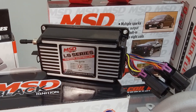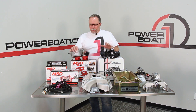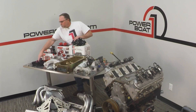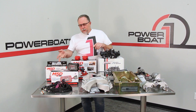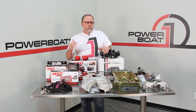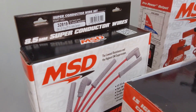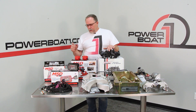Here's a little LS ignition controller. This is basically like an ECM — all it's going to do is really run the coils so the engine will fire and it'll adjust the timing and such. This is the little wiring harness that goes with it, plugs into your cam sensor and your crank sensor and will also plug into the coils. We're going to reuse those same wiring harnesses from the original engine for the coils. We've got a set of plug wires here — MSD stuff, really good quality. They'll run from the coils into our plugs.